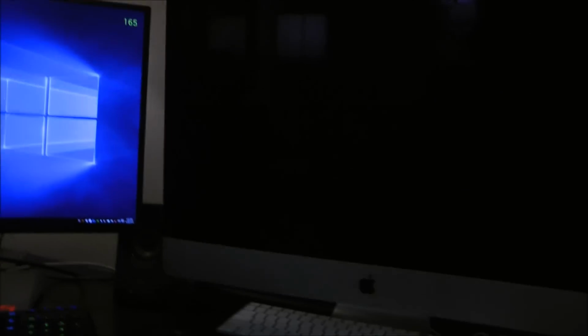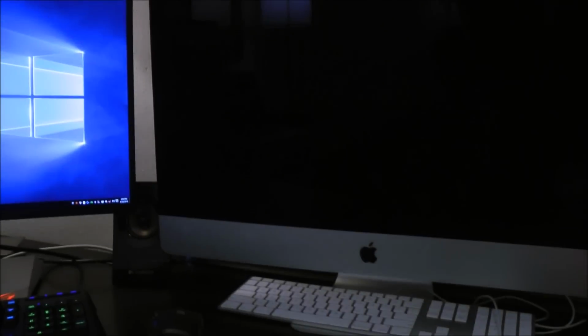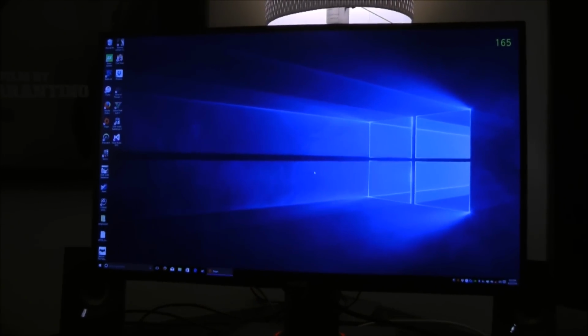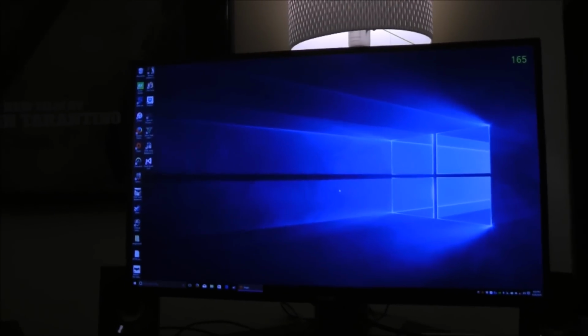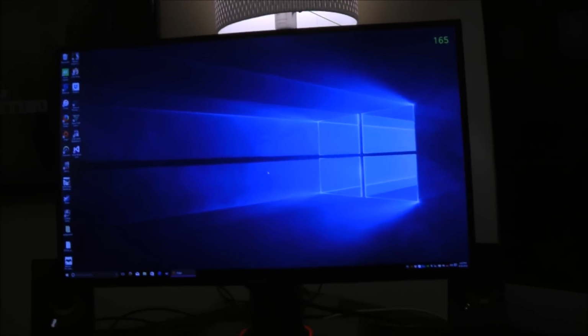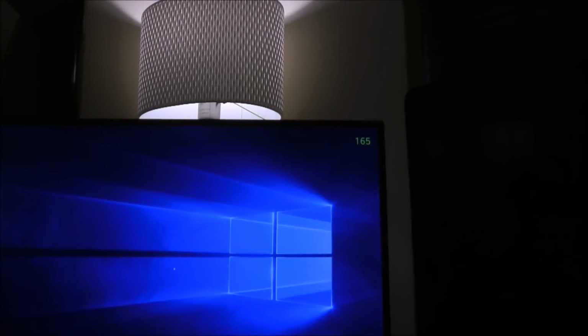And the other reason is, you can probably see my iMac sitting right here. I use this for work, and Apple's support documents said that this is a late 2013 iMac and that it can run an external monitor at 4K, but I could only get 4K at 30 hertz, and it was horrible. There's no possible way anybody could use 30 hertz, even just for day-to-day computing. I can get 1440p at 60 hertz, so that's another benefit of getting the 1440p. I really can't tell. I mean, with 4K you obviously get more resolution, but I like having the higher refresh rate, to be completely honest.